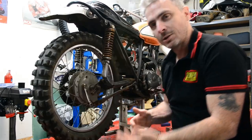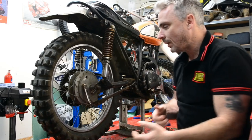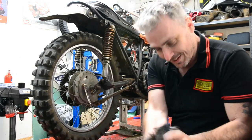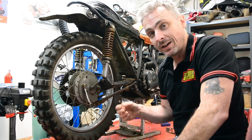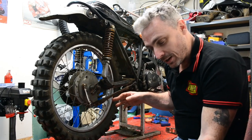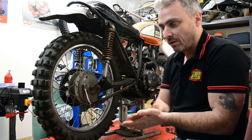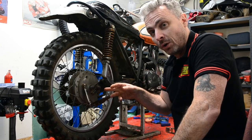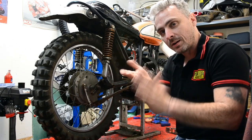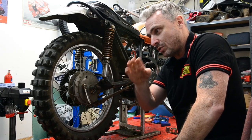There are a couple of reasons for this. It can either just be dry inside, could be all dirt in there with no grease or lubrication. Or it could be that the brake is low and the cam that operates it - that pushes the shoes apart - is turning too far before it gets a chance to return with the springs.